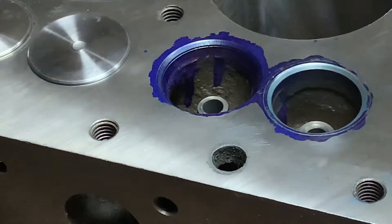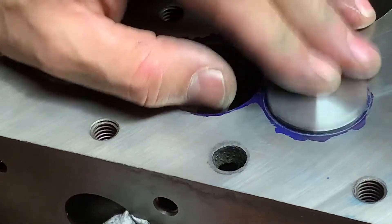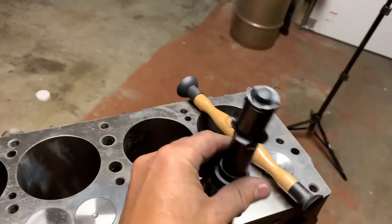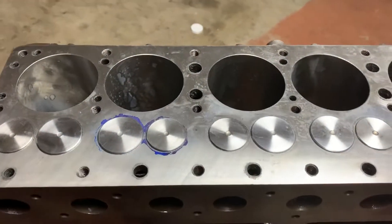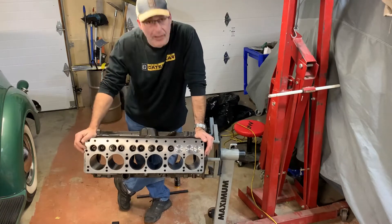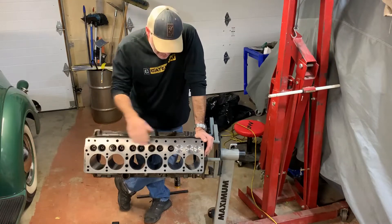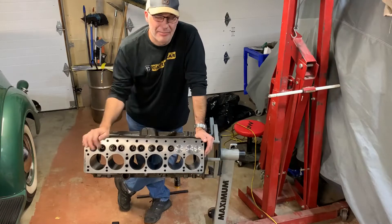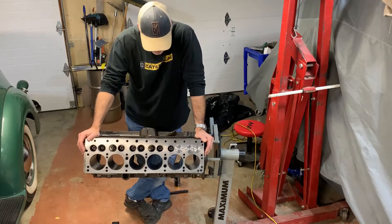This is the intake; this is the exhaust. The exhaust valve is getting better — I can see contact — but it's still not sealing and I'm still seeing light go through it. I gave him all my valves when I dropped off the block to be machined, every valve. I guess he didn't check them. I spent a lot of time trying to lap that valve. I even took out my hand valve grind tool — it's worked before — but I'm out of the coarse abrasive pads required to cut it. It's time to take it back to the machine shop. That's kind of annoying.